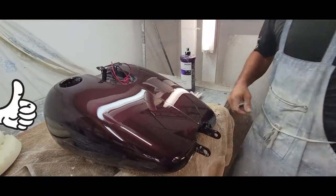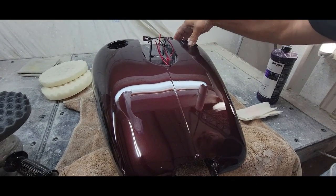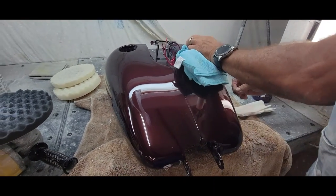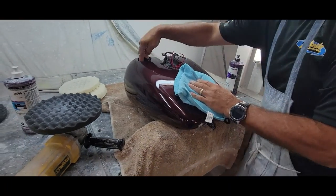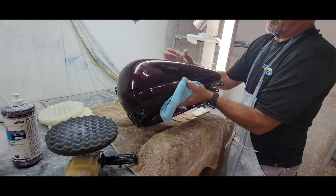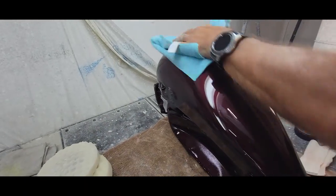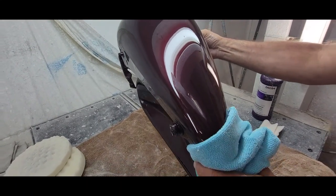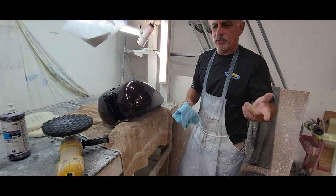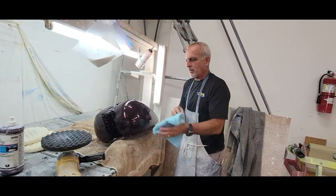Okay, there we have it — done! When you tape these up, sometimes they bridge, especially if you have candy and a bunch of graphics. Push down, and sometimes you'll need a razor blade to clean that edge out real good for the customer. We'll clean this up, remove all the tape, and wipe it down real good. See how good the side came out — show quality. We've still got the fenders left to do. Hopefully this video helps you — if it does, appreciate the subscription, subscribe to my channel, thumbs up, appreciate it. Next video coming soon.